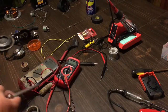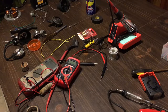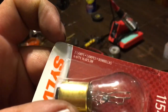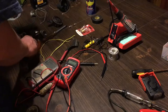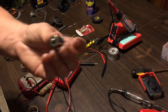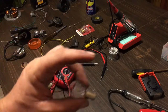If that doesn't fix it, then you need to replace the horn. Now, the brake light bulb on these bikes is a 1154 6 volt. The marker light bulb, which is a single filament, is a 1129. Your directional bulbs are also 1129s.